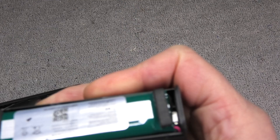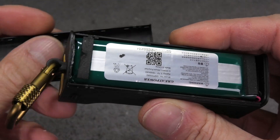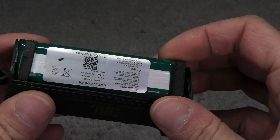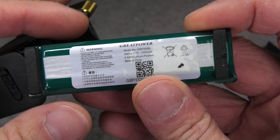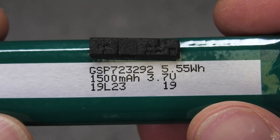The reason to be very careful is that the battery is located right underneath the cover. If you poke with your knife or prying tool too deep, you're going to poke into the battery, and that is really bad - the battery may actually catch fire. So please be really careful when you do this.